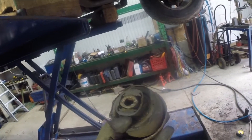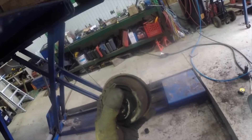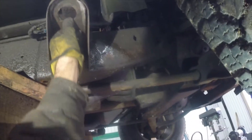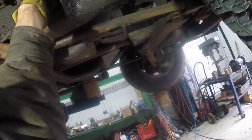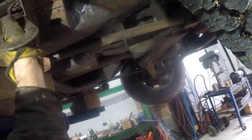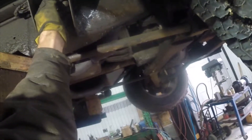You could also use a hole saw to cut this hole out. The factory hole wasn't a circle — it's got flat spots because the mount needs to be oriented so the long part of the center metal section is parallel with the running boards, and these edges of the mount go through flat sides in the bracket. I've cleaned all that metal out of there and I'm going to hit it with a wire wheel before I weld it. You can see how nicely that fits up there. Before you weld it on, I suggest putting the mount back in place, lowering the cab down, and making sure the hole is in the right place — when I did that I realized I had to grind out one edge of the hole a bit.